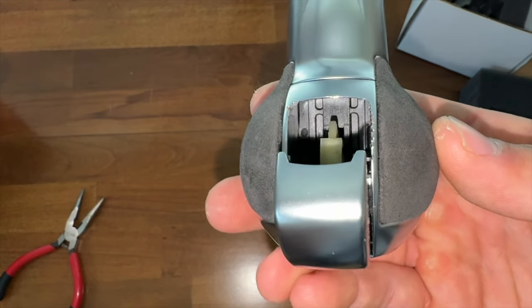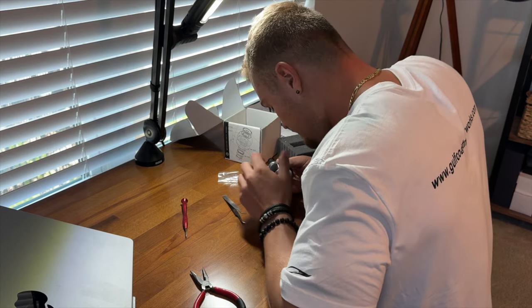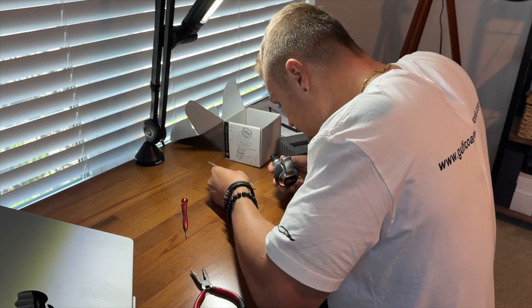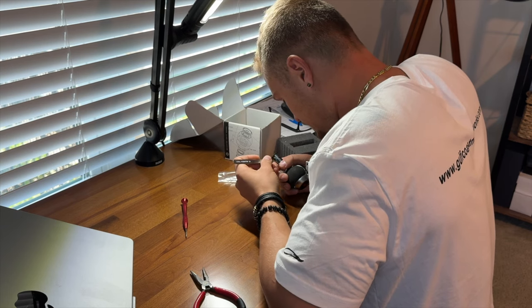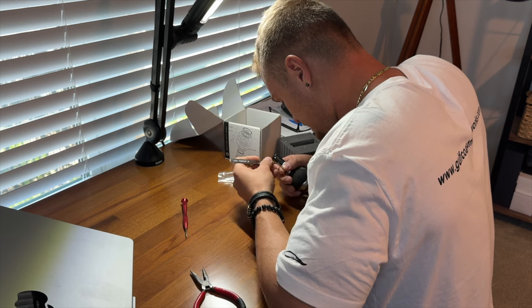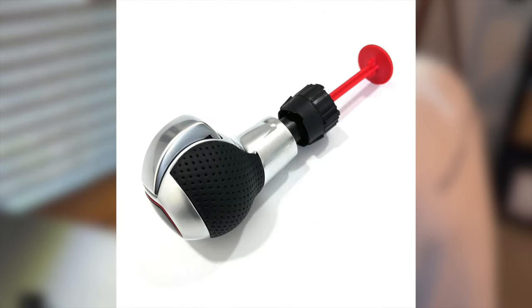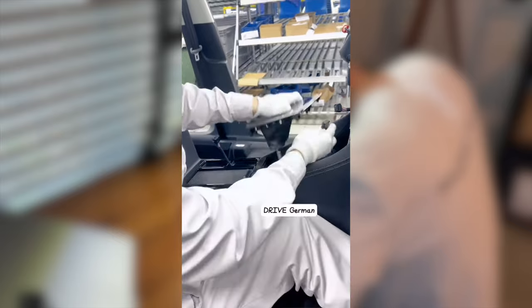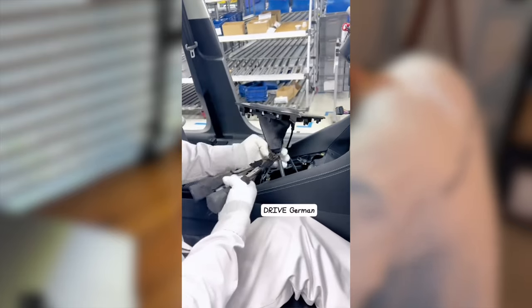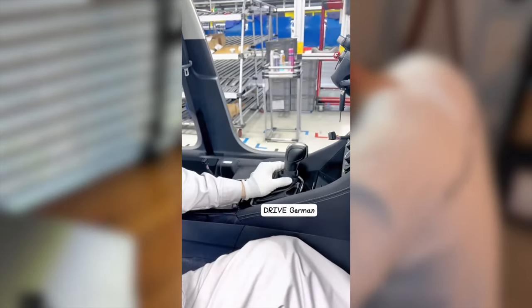You want to circle it around those two areas right there, and I will be back shortly to show you what it looks like after they're connected. Now as far as I understand, the dealer — Audi — won't fix this for you and they might even tell you it's completely broken and you'll need to purchase a new one, which is several hundreds of dollars. No fault of their own, because even at the factory these parts come pre-loaded or pre-tensioned. If you look at this photo you can see there's a red stick, and what that does is it locks it in place so that this button doesn't accidentally go off during transportation. Once that red stick is removed, they can then force it onto the shifter mechanism, and then and only then do you touch the button.